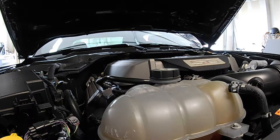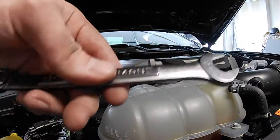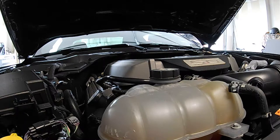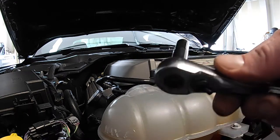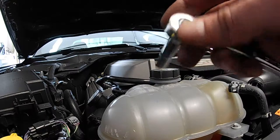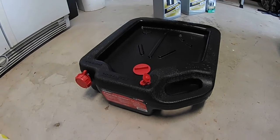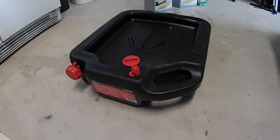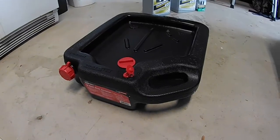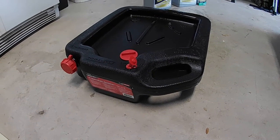Tools for the job: you want a 15mm wrench — just a standard wrench. And you're going to want your 7mm socket for that panel underneath to get to your oil filter. You're going to need something to drain into. I like this drain pan because you just dump it — you don't have to pour it after you're done, it seals up nice. Throw it in the trunk in a plastic bag and dump it at your local auto parts store. Plenty of room for 8 quarts coming out of this car.